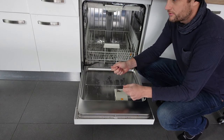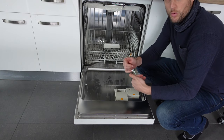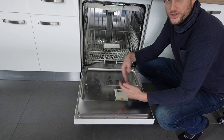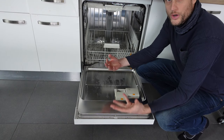An E1 error is basically when you turn the dishwasher on, it tries to fill up with water. And depending on the water flow, it takes shorter or longer. If it takes too long, it will eventually time out because it senses that there's an error getting water into the dishwasher.